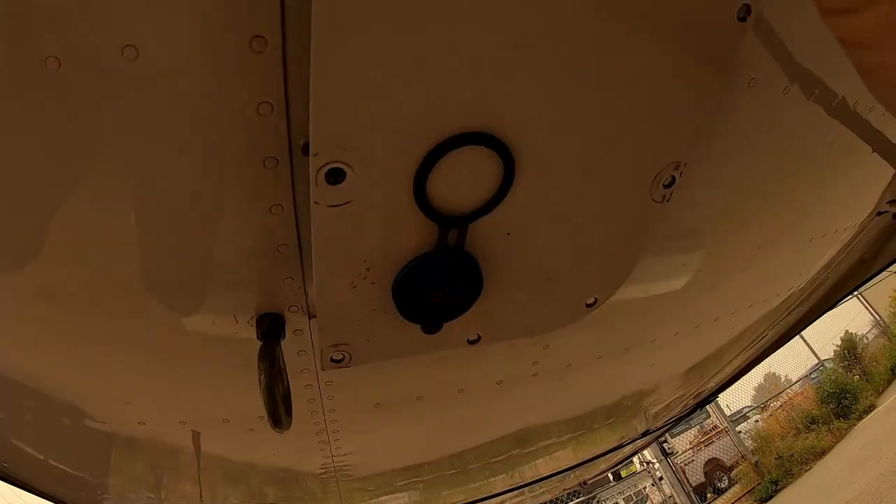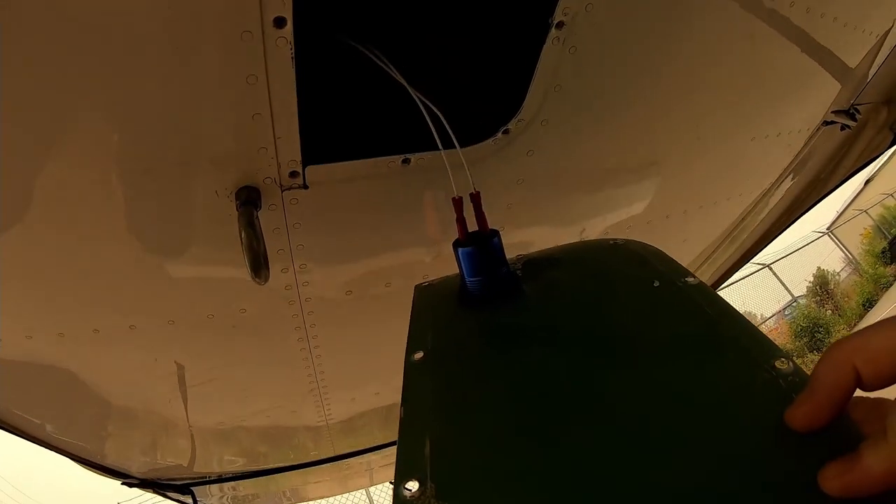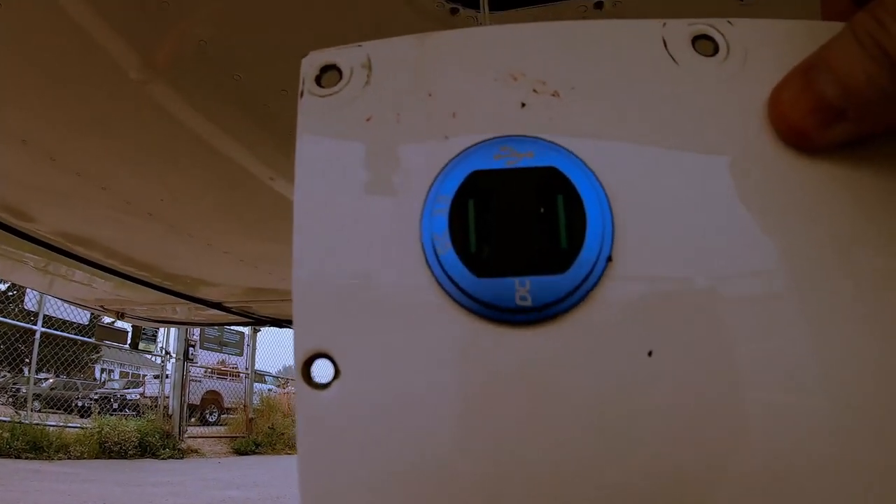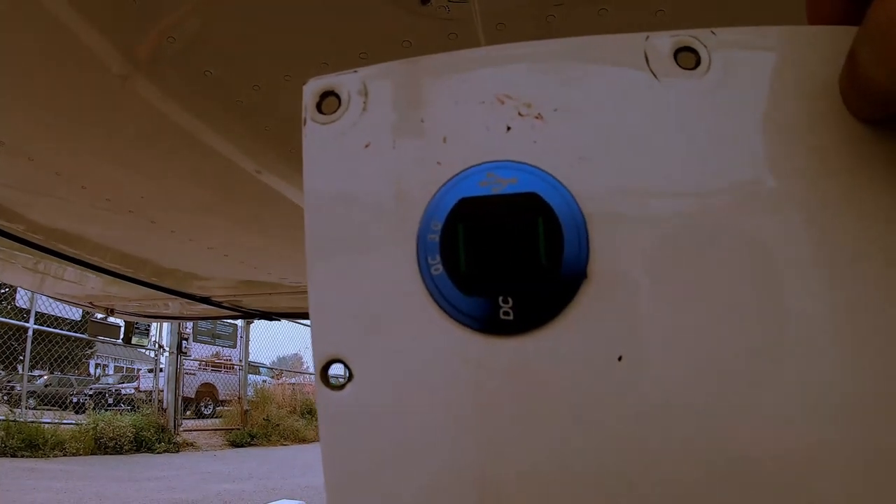First let's talk about the USB port. I put one under each wing — it's wired into my nav lights out at the wingtips, so as long as I'm supplying power to the nav lights I'll have power to the cameras. I'm hoping it's going to alleviate the problem I run into particularly in the winter of the cameras dying 30-40 minutes into a flight, because normally by the time I hit record and hop in the airplane, get everything ready, start up the engine, taxi out, do my run-up, I'm already 10, maybe 12-13 minutes in before I even get off the ground. So sometimes my flight time on the exterior cameras is pretty dismal.